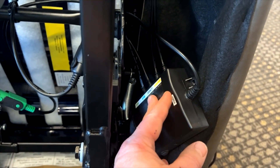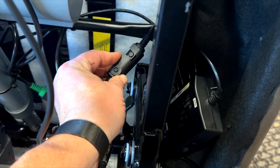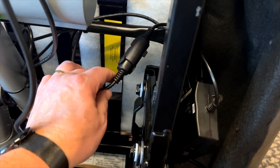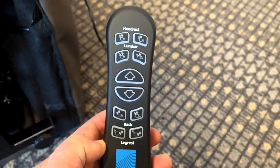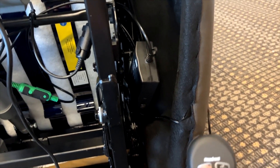I'll go through the connectors and how to trace the wires. The first one is the power — this cord comes right through here and is in this black connector. A key thing when diagnosing electrical furniture is to push a feature button on the wand and then wiggle the corresponding wires that go with that particular feature.